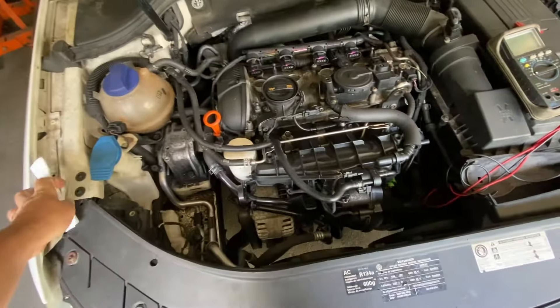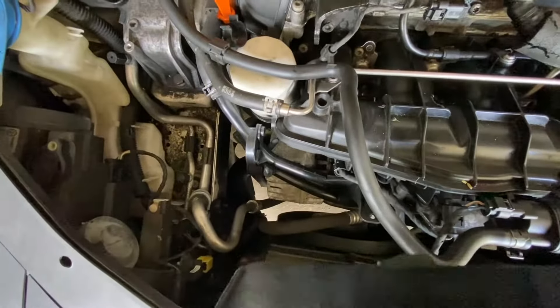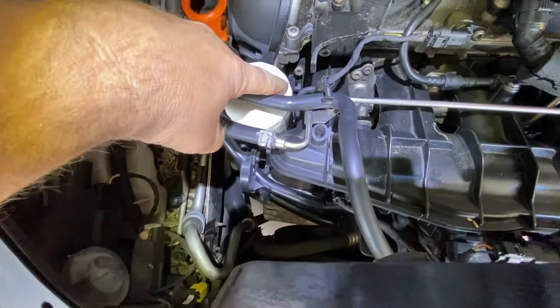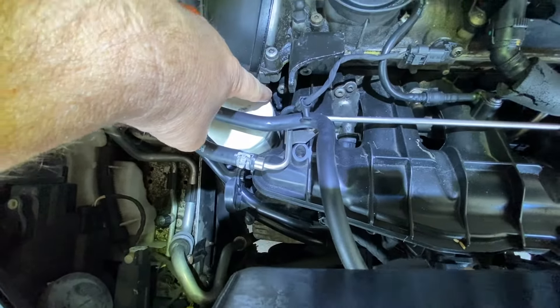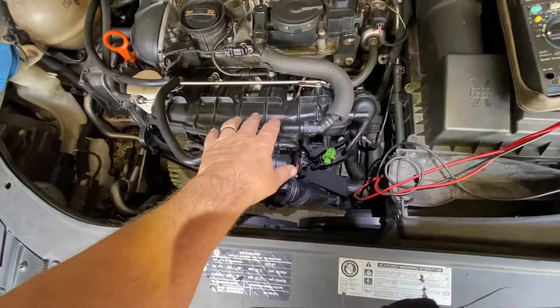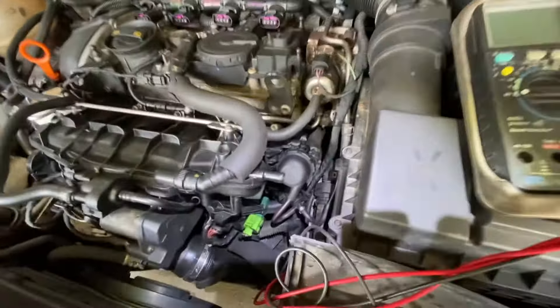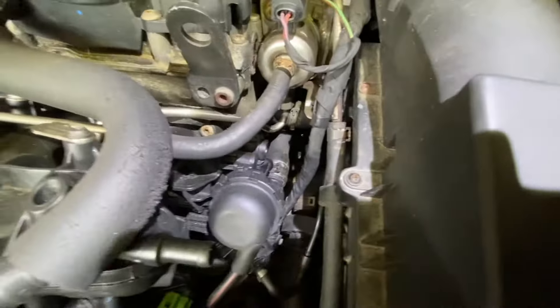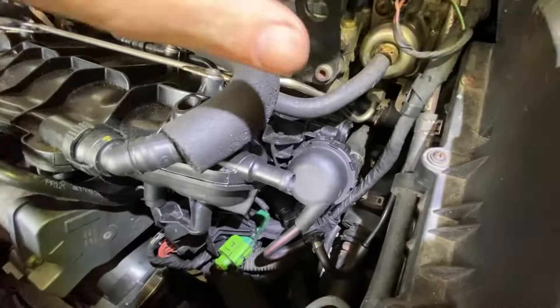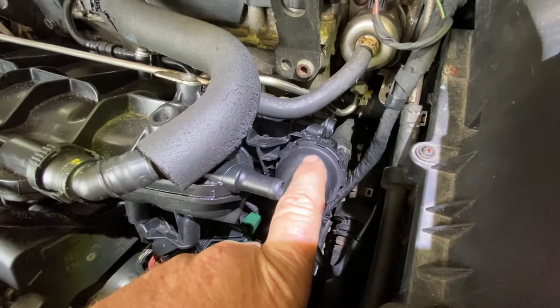Basically, it's saying the sensor — the sensor is right here, right where the filter is — but it's usually not that sensor. These cars have a major recall on the manifold. What you're going to want to look for: the engine cover's off. If you take the engine cover off, you look at this vacuum valve right here and where it's connected to.